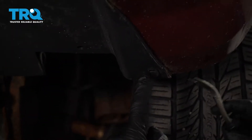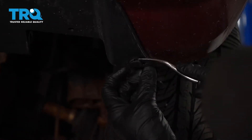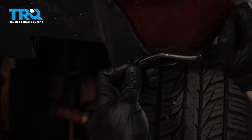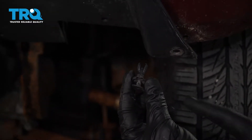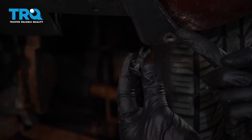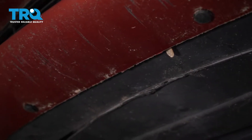Underneath the front, you're going to find all the pins that look just like this. We're just going to carefully get in between this area. You want to pull out the center aspect of this — that's going to unlock the push clip. Then once you have it out far enough, the whole thing should just pop right out. Once you pull out the center locking aspect, it releases these two ears, which makes it unlocked and you can go ahead and remove it.